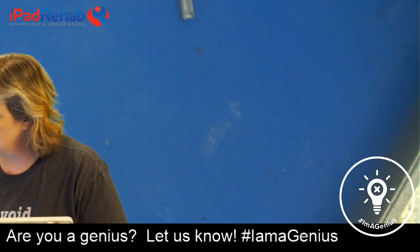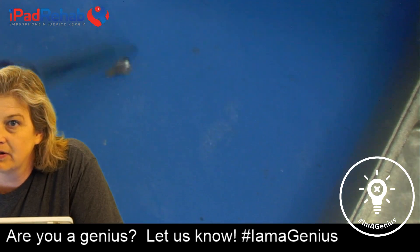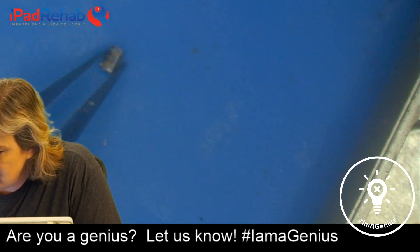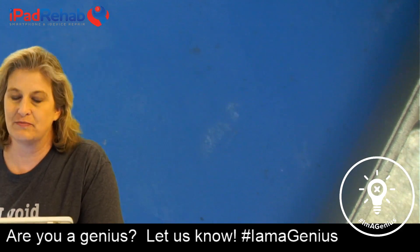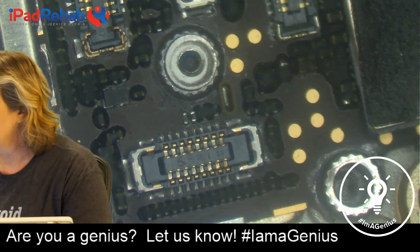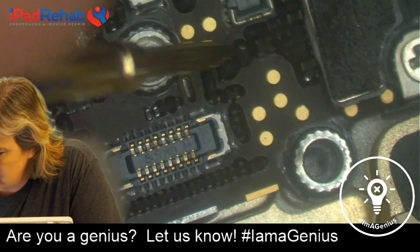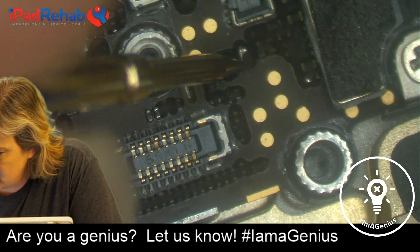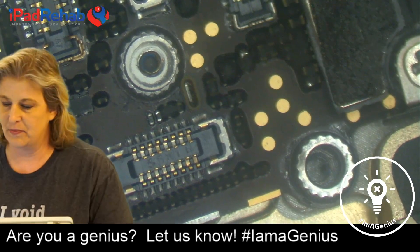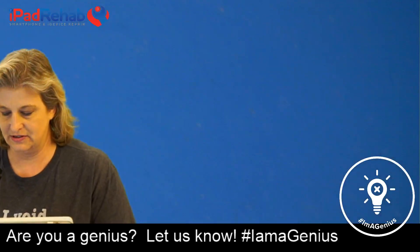Let's ask this cap: are you a wire? Capacitors are not supposed to be wires. Testing it — yes, it reads as a wire, and you can see it looks burned. That tells us this is going to be solved. Checking with the multimeter in diode mode: the main power rail on an iPhone 6 should read about 0.33, and now both sides of the cap read 0.330 — we're back to our normal diode mode reading.